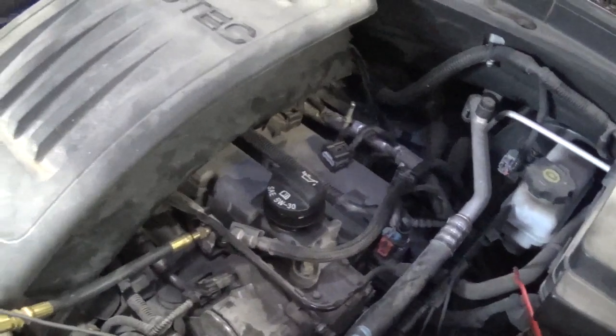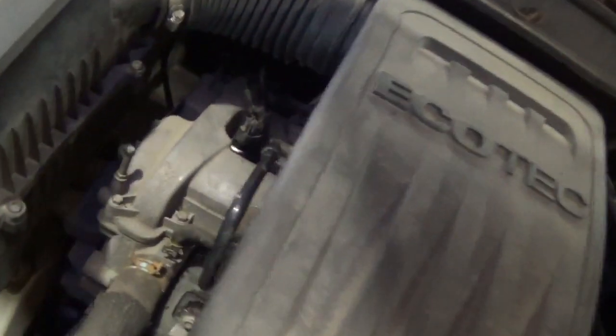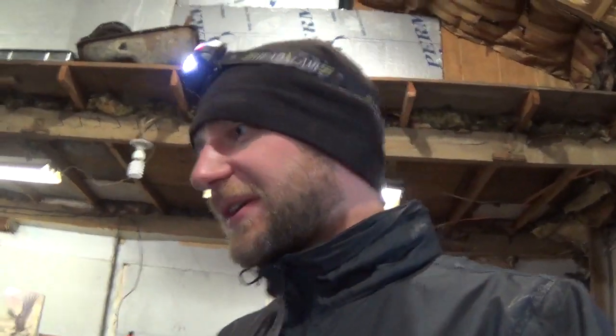The other piece of information that the shop owner here, Jim, tells me is that when this car came in it was 3 quarts low on oil, and the capacity is less than 5 — for variable valve systems that is a big no-no. So we suspect the timing issue. The engine is quiet, so I wouldn't say the timing chain jumped or the tensioner is loose, but we're that far advanced and activating that solenoid doesn't do anything — doesn't advance it, doesn't retard it. There's definitely something going on mechanically, but let's pop in the pressure transducer and crank it over and see what kind of waveform we get.